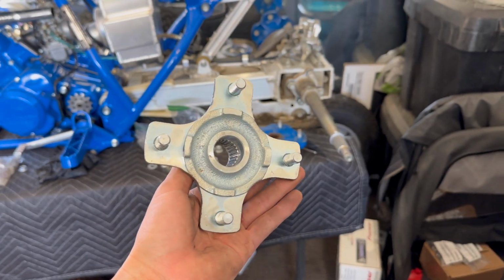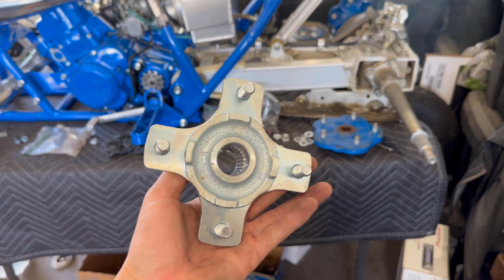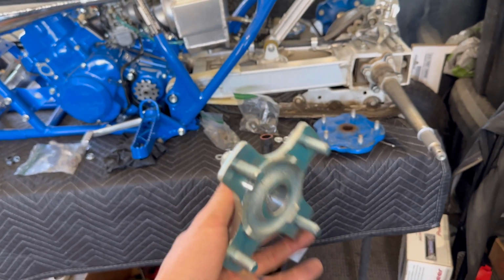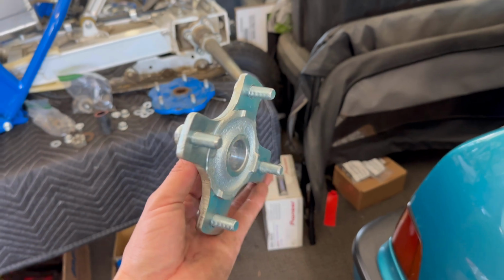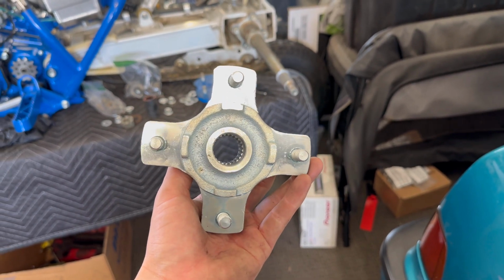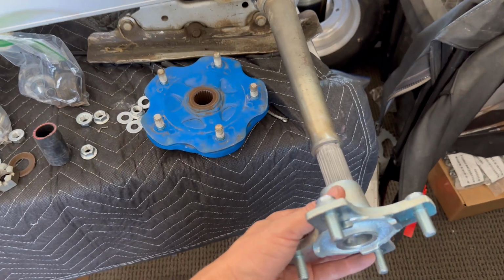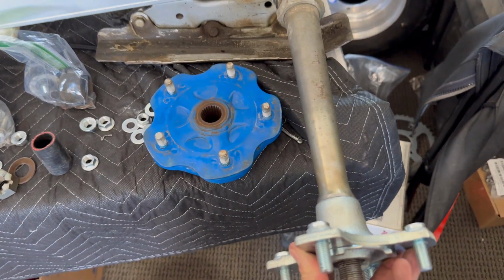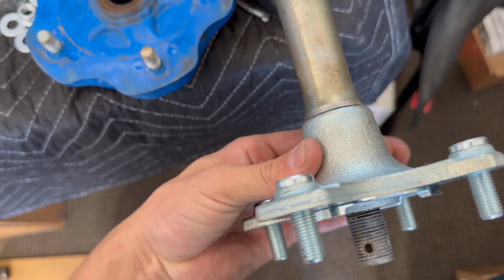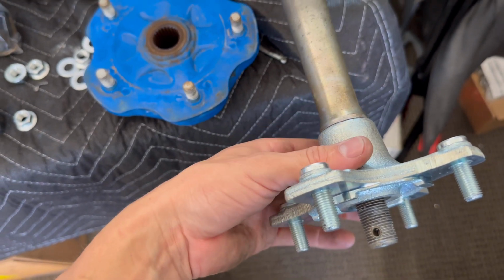Keep in mind, these are brand new hubs, so the splines are super sharp. People claim that the original Yamaha hubs slide right on and off, which is believable because they'll be used a bit, but this is reproduction. I'll put the link in the description below, but either way, check this out. I put anti-seize on the splines. That's how you know you got it perfect. And there is 0 slop, no movement. All you're doing is knocking the ridges down just a bit.